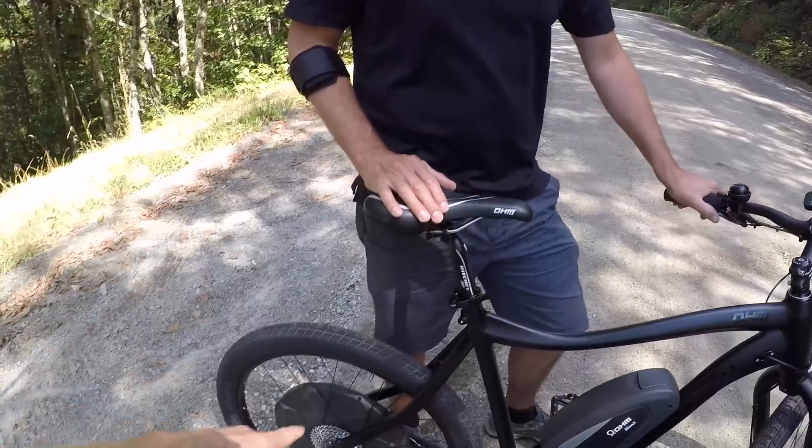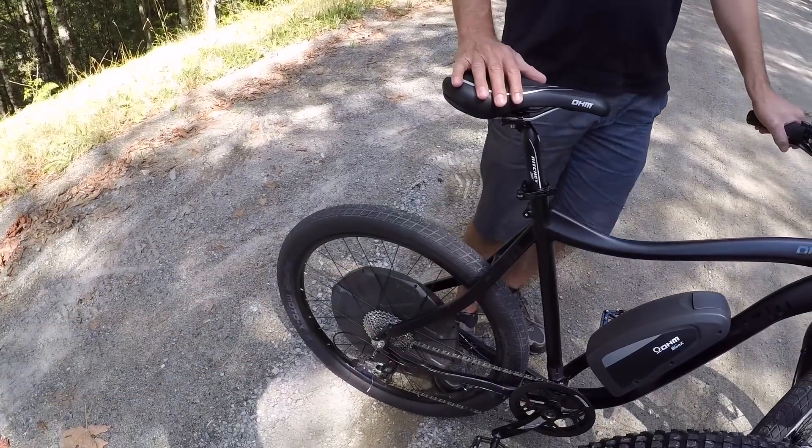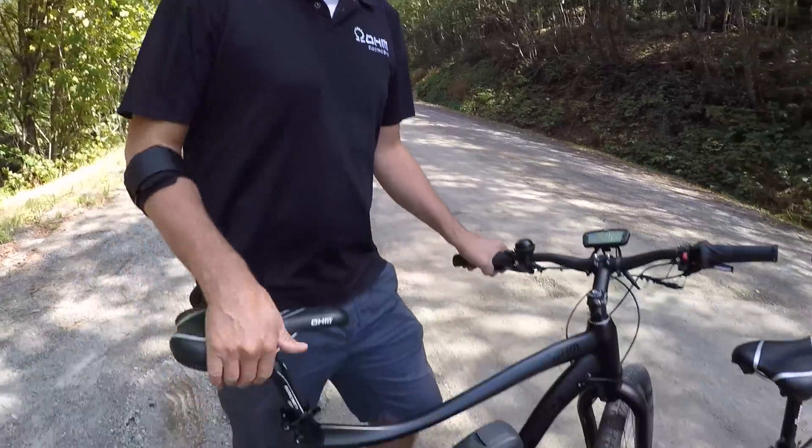On snow, we've tested the fat tires and five PSI seems to be the sweet spot for really good traction. Also, this tire is designated as EPI rather than TPI, but that's just another way of describing the density of the tire — basically the same thing. Thank you very much.